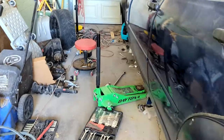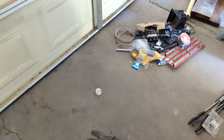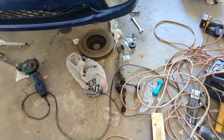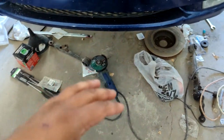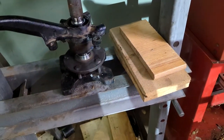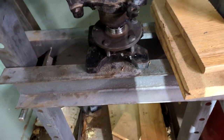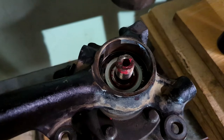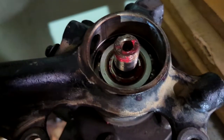There are a couple parts of the video file that were corrupted and weren't able to edit quite well. So two things I want to add: one, when you're installing the actual oil seal or grease seal that goes on the bearing, don't use the smaller one. Use one that is exactly the same size as the actual hub so it sets flat. The last thing you want is for the oil seal to go on crooked — just get something that covers the whole surface area and will not fall into the actual hole. So here I'm using a 32mm socket to go over the inner bearing race and push this thing in there. The inner spline is in — I put the Deepwell 32mm socket on the inner race of the bearing and pressed it on in. It went in nice and smooth.